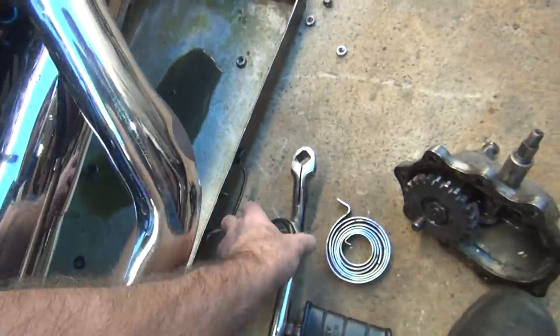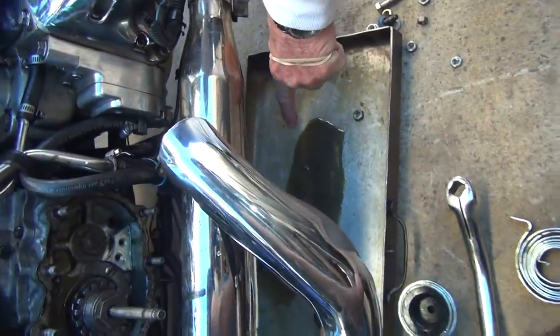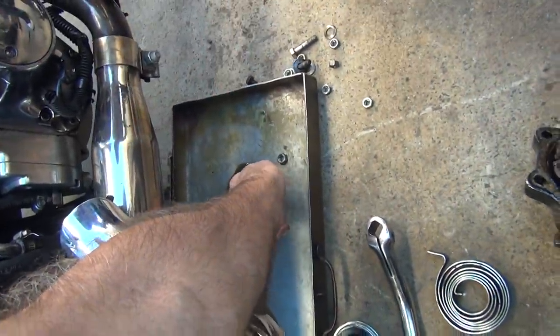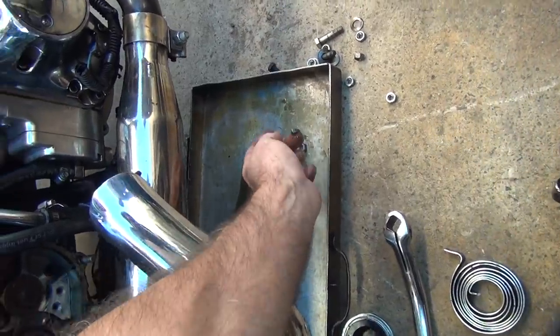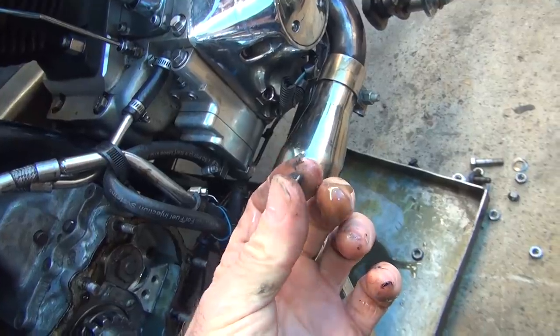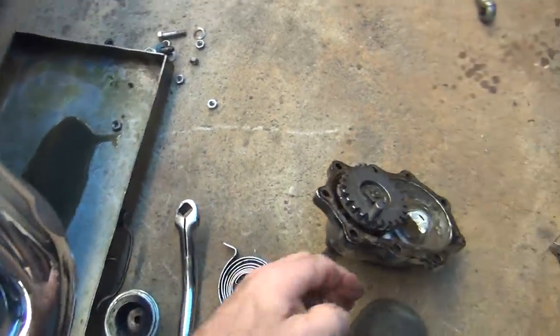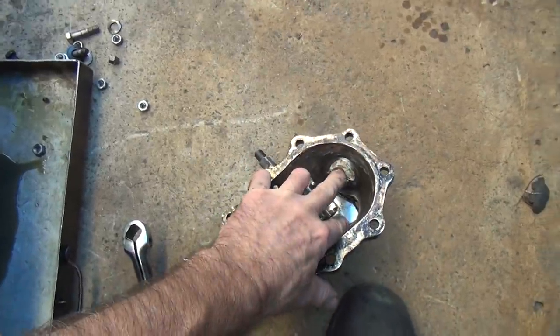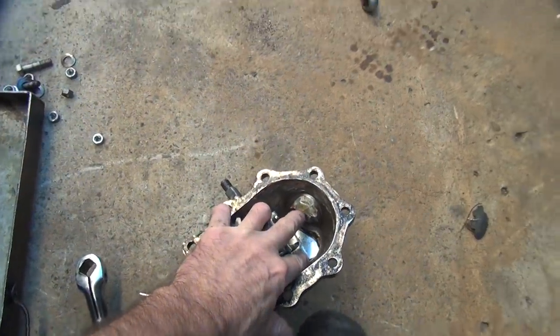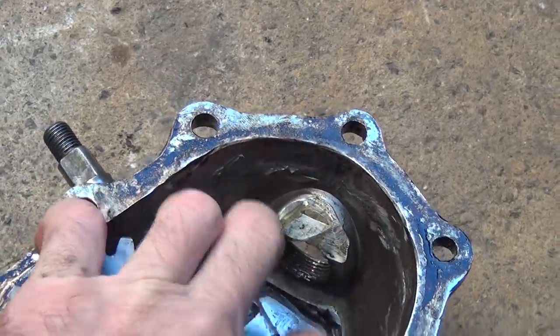That's optional though - we don't want too much fluid in things. That little thing fell out when he pulled off the push. Yeah, that came out of the area. He said he had a different push rod - yeah, well that's the end of a push rod. So whoever ground the case, they put a big hole right in here. That's why there's no oil - it just leaked right out there. You should have more than about half an ounce of oil in your motor.